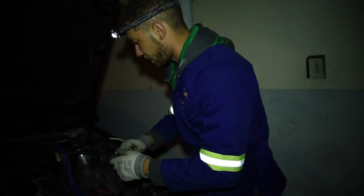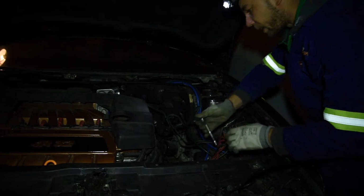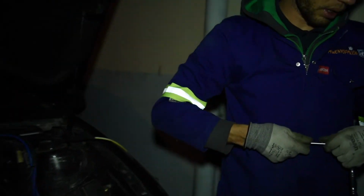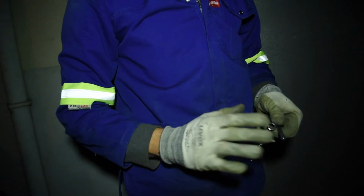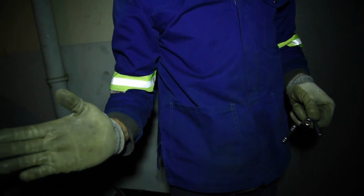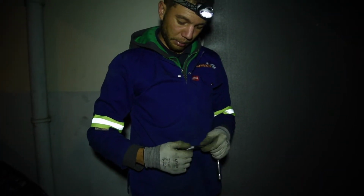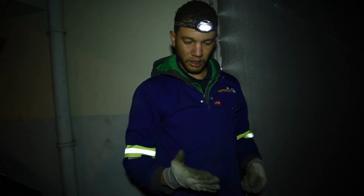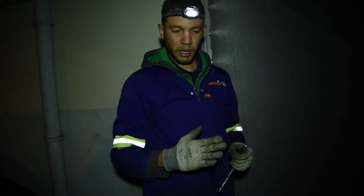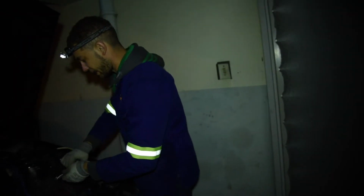So let's say, for example, the best example I can give about that is your throttle. As a simple case scenario, your throttle, let's say wide open. Wide open would be flat foot. We call it WOT, for example, would be 12 volt. Halfway would be 6 volt. And all the way off would be 0 volt. This is just an example.